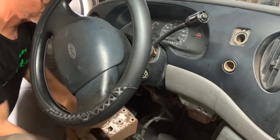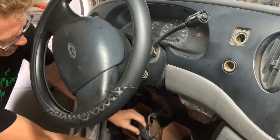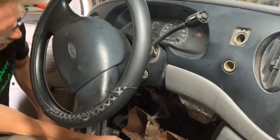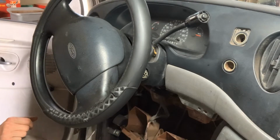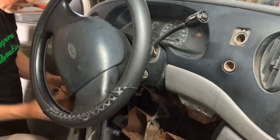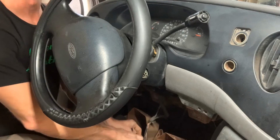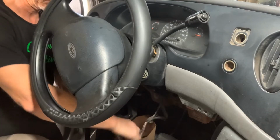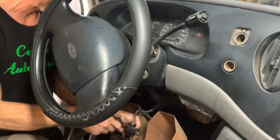Okay, and then underneath that's your ALDL connector. So right there. And we're going to go ahead and take that off. It's got a Torx bit in it. Yes, we could use that, or actually probably a 7 millimeter, 1/4 inch. My 1/4 inch little Milwaukee battery fell in an antifreeze bucket the other day. So, a couple of 8 millimeters, and we'll just take our ALDL connector, OBD2 connector, out of there.